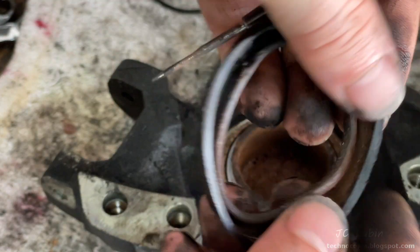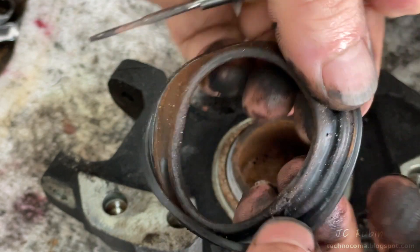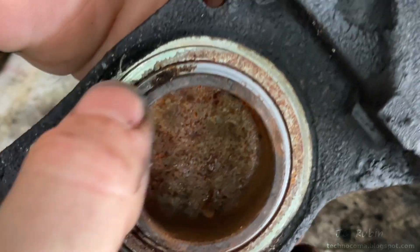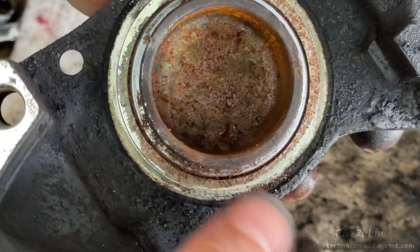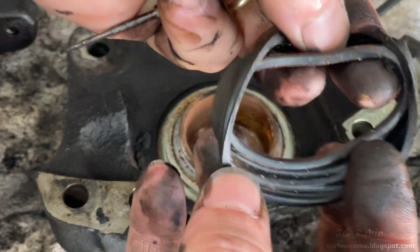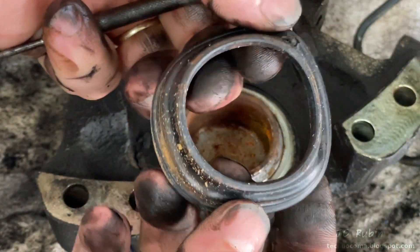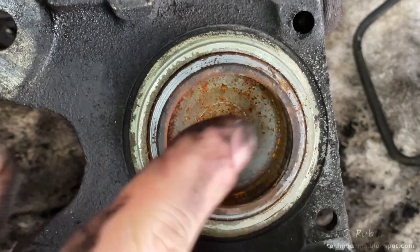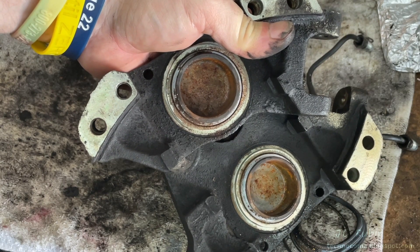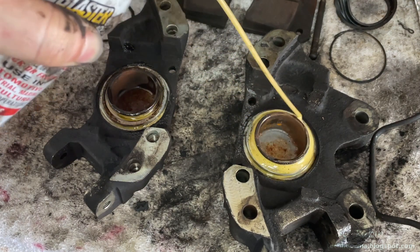This is in very good condition — we can see a little bit of surface rust got in, but pretty good, I'm impressed. Here again, very good condition on the caliper. We'll repeat the same thing on the other side. This one also looks absolutely fantastic, except for the hole I poked in it. The caliper pistons also look good as expected. I'll push these pistons out now to see what we're working with — applying a little penetrating oil before I do, just in case there's benefit.